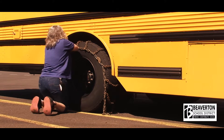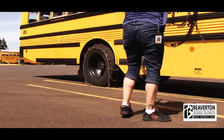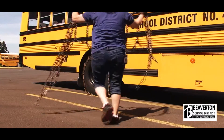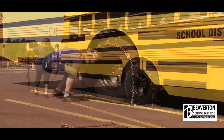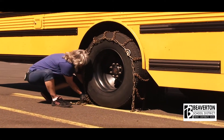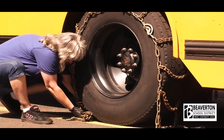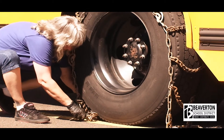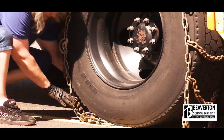This should allow just enough chain to hang down in back of the tire so you can tuck it under the edge of the tire and it will not slip when you back up. Always have the extra chain length at the front of the tire so you can back onto the chain and hook it at the front. You don't want to fight the mud flaps. For your safety, be sure to bend at the knees to pick up the chains. Hang chains on both outside duals. Tuck ends at the back of the tire under the tire. Back the bus approximately 2 feet — or the width of the front passenger door — so the end of the chain clears the front of the tire by 6 to 10 inches.